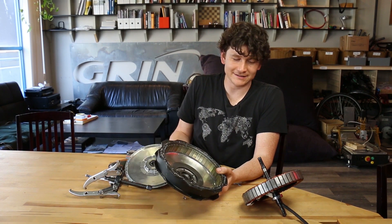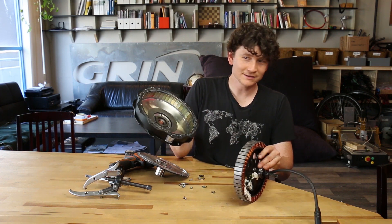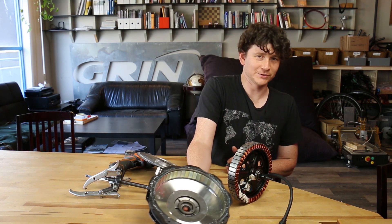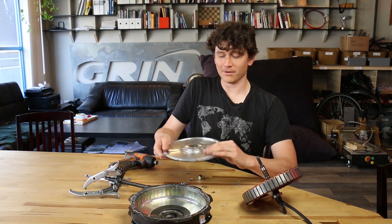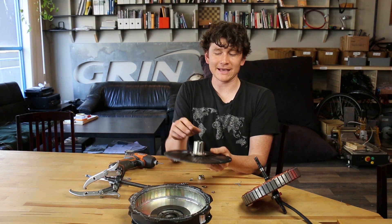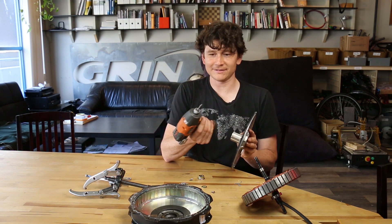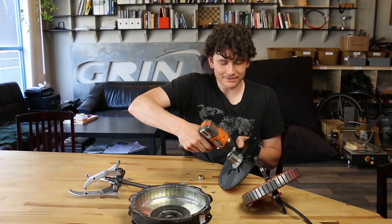With the stator completely free and both side covers free, notice that when I pulled off the motor shell, the ball bearing stayed on the axle rather than staying inside the shell. It's a 50/50 gamble which side the bearing fits — it depends which interference fit was most tight. On this side plate, the ball bearing has stayed in the side cover. If you want to replace a damaged cassette freehub, you can further remove the freehub body. It's the same T20 Torx driver that holds the six bolts of the cassette in place.